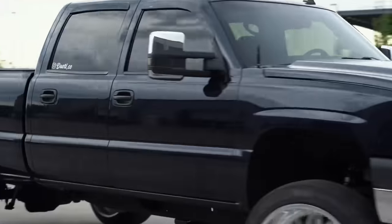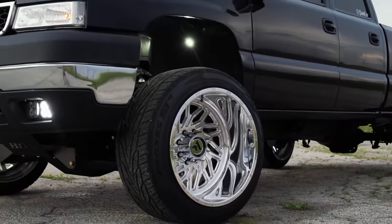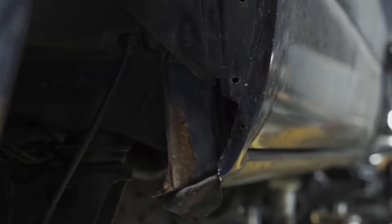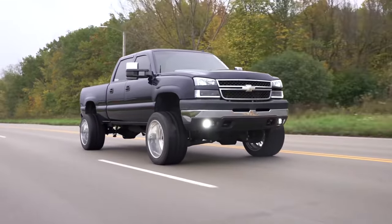Here's why we really hate square wheel wells — and I can say that because I have one. They're okay, but they're a pain in the ass. If you're a truck guy or gal like us, chances are you can't leave anything stock, and one of the first mods is new wheels and tires — usually bigger and wider than factory. There's some flexibility if you're leaving your truck stock height, but square wheel wells really suck to fit anything bigger than a nine-wide into. This is because where most round wheel wells give you room on the backside, square wheel wells are about three inches more forward and then they square off, and all that material means chances are it's gonna rub.